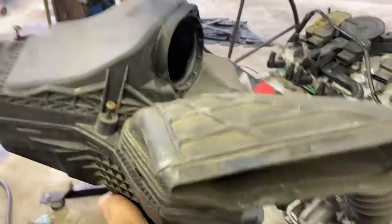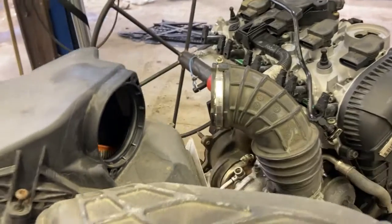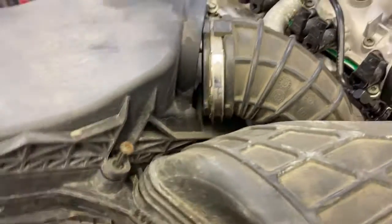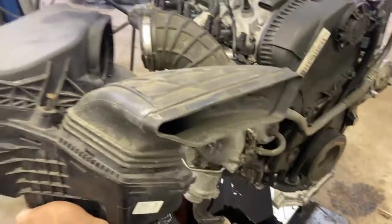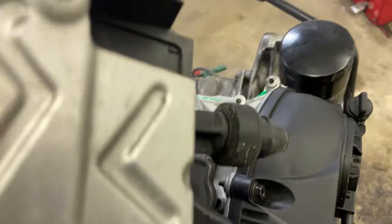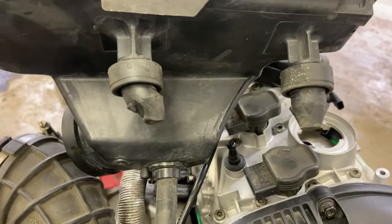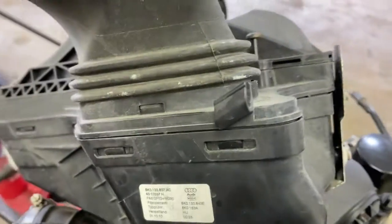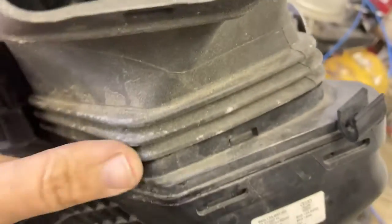This is the bread and butter of the video — we're talking about the air box. This right here in my left hand is the factory air box. This right here would be called a snorkel. It's kind of like your air dam in the front of the car to try to get some ram air at highway speeds. There's supposed to be a mass airflow sensor in between right here — right now it's unscrewed. The air filter is right in that hole. There's only six screws to pop this cap off. It sits like this.